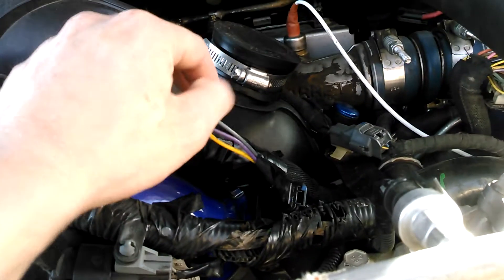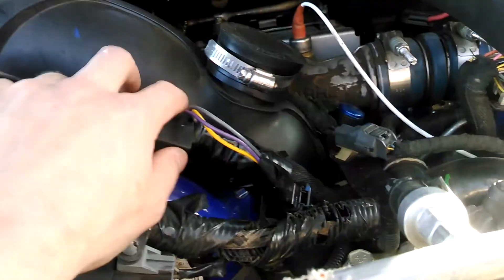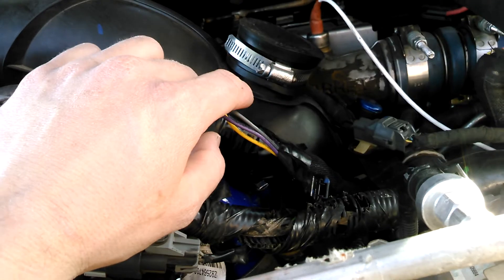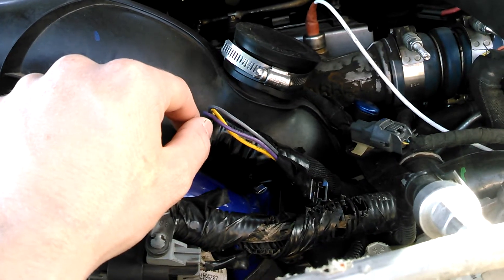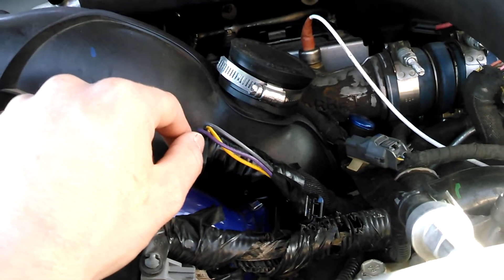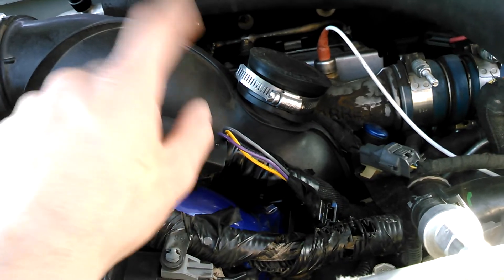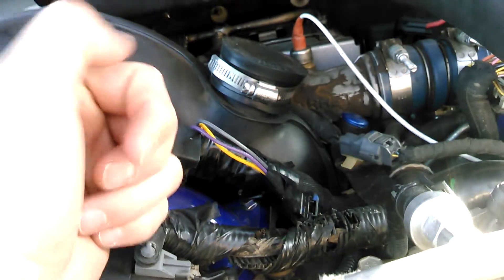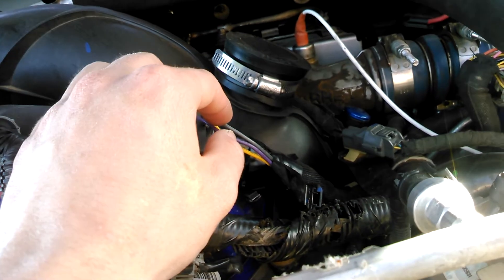If you're wondering about these wires — long story short, a mouse got in. I live on five acres out in the country, and a little field mouse or squirrel got in and ate my wires. I was popping some weird codes, started the truck to go to work, it started beeping and flashing, put the truck in limp mode. I got my AFI Live scanner out and it popped a P0090 code, then I opened the hood and there was a big nest right there.